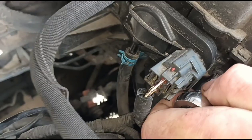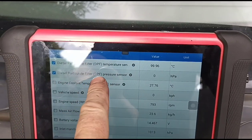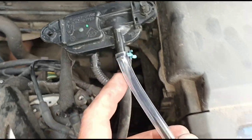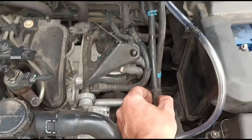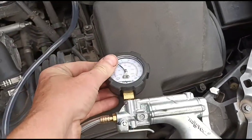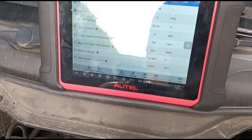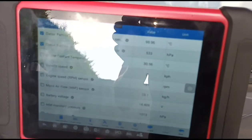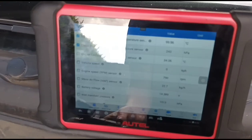The first thing I'm going to do is take off this pressure sensor, opening the T25 screw here. Here we have the particle filter with zero pressure showing. I've just connected my midi vac to this side - this tube runs down to the top of the catalyst and particle filter. We're going to increase the pressure on here and see if it increases on the screen. Getting it up to about 10mm to see if that's dropping.